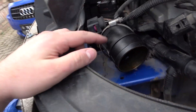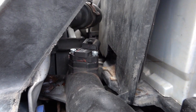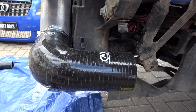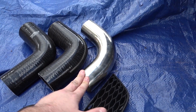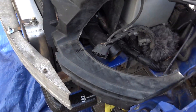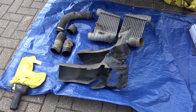From here we need to turn and go up through the hole and up to the charge pipe which is there. There's a headlight there so I'll slide it in and see what clearance we've got. On this side there's the MAP pipe with the MAP sensor - we're keeping this MAP pipe and connecting onto it, bringing us into our pipe. I've got a couple of options: a short 63 mil elbow and a longer one. Depending on what works best with the headlight clearance, I'll have a little play around and work out the best solution and sizes.